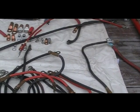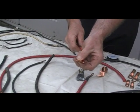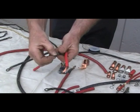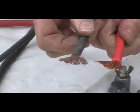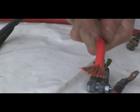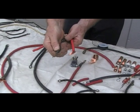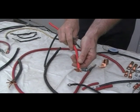Moving the camera over, here we have a 4-gauge cable — this is what we call battery cable. This is not welding cable; this is starting cable for your automobile or perhaps your boat. Whereas good 6-gauge cable used in golf cars has many, many strands — about 250 strands of copper wire, versus about 49 to 60 strands. This is a standard golf car battery cable, and this is a standard automotive starting cable that you would find in your auto parts store.